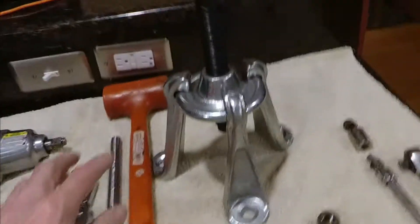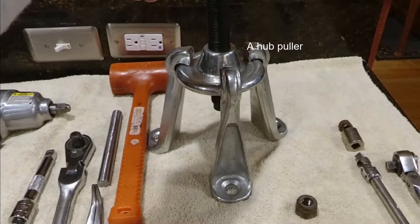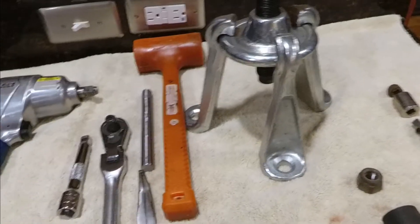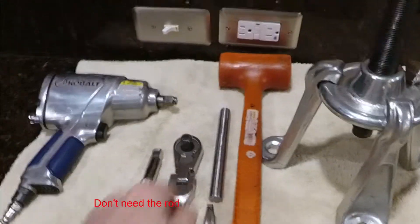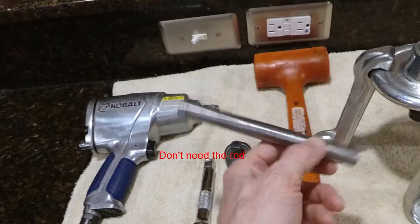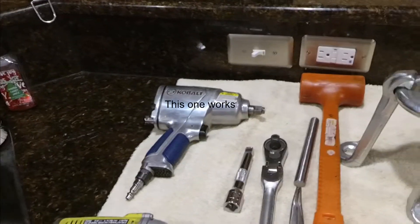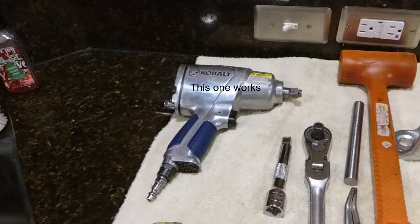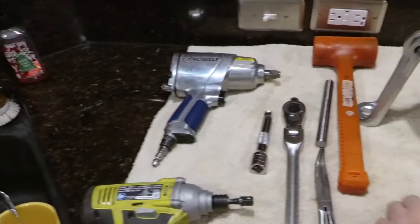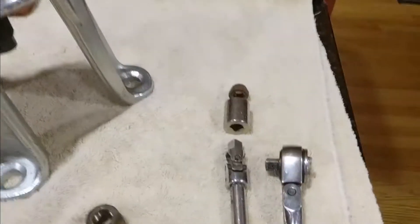The ratchet. This is a puller — it's going to remove the carrier from the half shaft. You are going to need a hammer. This is a 5/8, 6-inch long piece of steel that you are going to use to pound out the carrier bolt that holds the carrier onto the half shaft. I found that an impact driver works nicely, though it isn't going to be enough to remove the castle nut or break it loose, but it does work fine for the half shaft nuts.